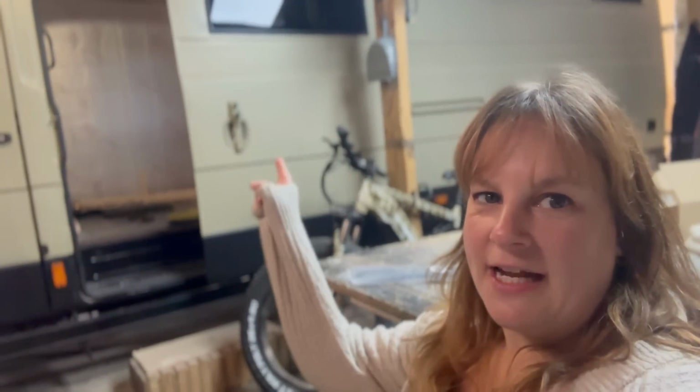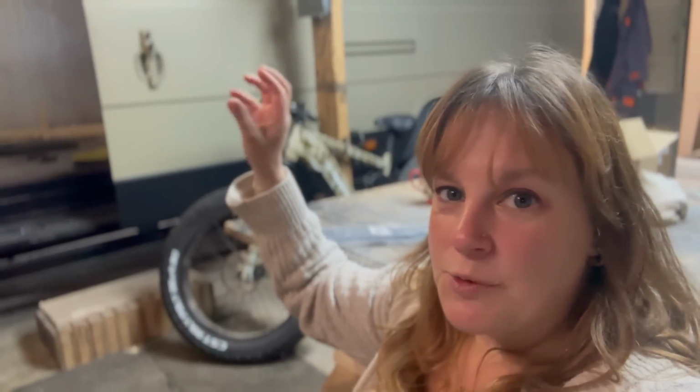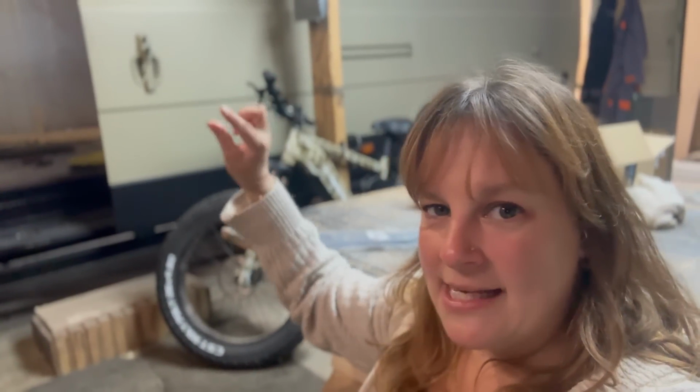So after Mel has been fiddling with the door, shutting it, opening it, locking it, opening it again, he was finding that every time he locked it, the handle and everything worked now, which was really good. But when he locked it and you tried the handle, if you were to forget it was locked, simply trying the handle and it not opening was jamming the mechanism further on in the door. So now he's had to twizzle it a little bit more, by one turn, isn't it? And then add a spring to allow the catch to fully open and return the mechanism back, so that when you lock it and try the handle, it doesn't foul up. You can try the handle, nothing happens, then you unlock it and it all opens up in one go, if that makes any sense at all.